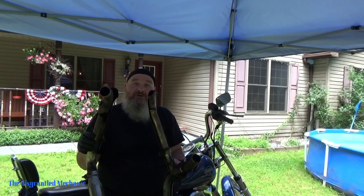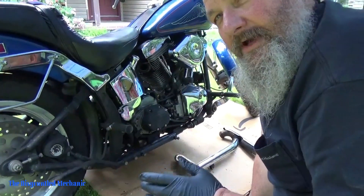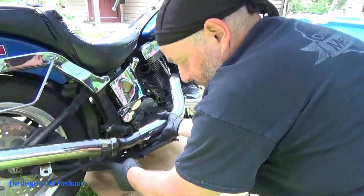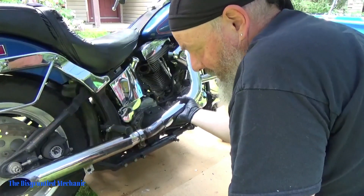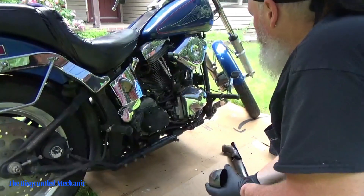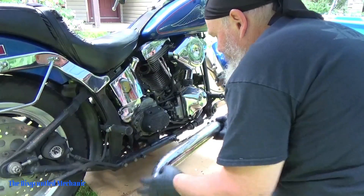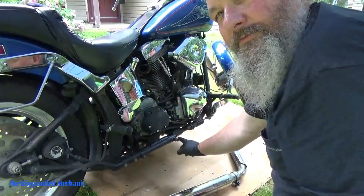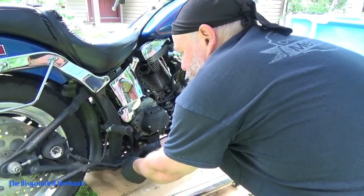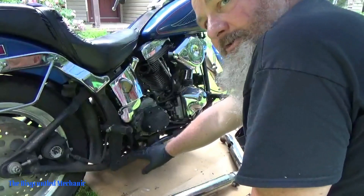It really wasn't that hard, and then I'll show you the new ones that I got and exactly what they are. For my particular bike, the way it was mounted, you had to take this bolt off back here, which basically held this pipe on. That was all that really held that one. Then your front pipe, which goes up in here, that went on to this bolt down here. Now to mount the new ones, this whole mount comes off — all this was basically your exhaust mount — so this comes off and goes away.